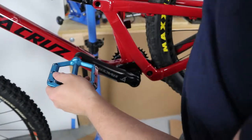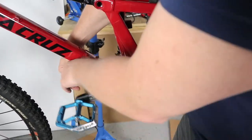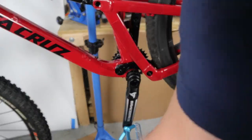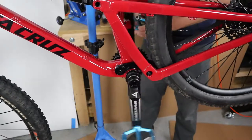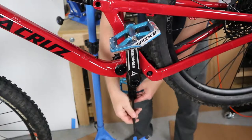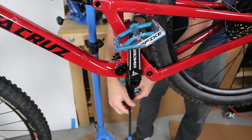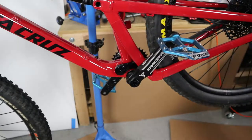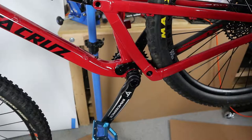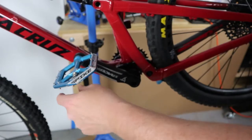The easy way to remember: this is our left, non-drive side. These actually tighten from the back — the easy way to remember is you tighten it toward the front to tighten it. I'm not going to put much pressure on there. The other side — the drive side — is the opposite. For the drive side, remember you want to spin it toward the front tire. You can also look at the thread pitch to determine that as well. Just remember that when you're pedaling, it always wants to continually tighten versus loosen, and that ensures that the pedals will never reverse-thread themselves.